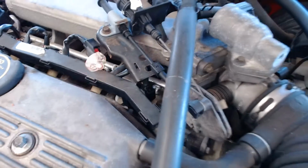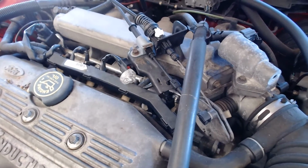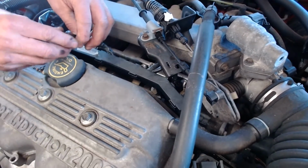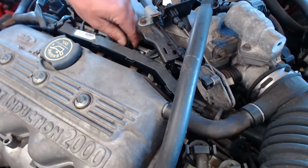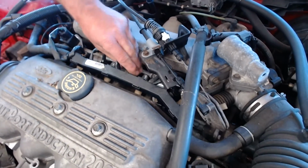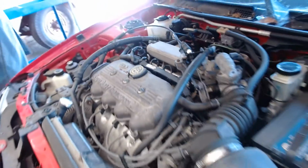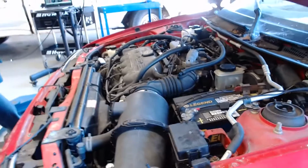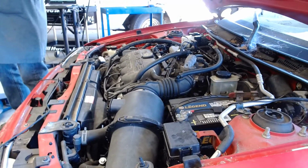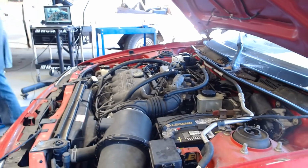So, is that injector being flashed? Sure is. So now, look you guys, if we got gas in the tank, and the fuel pump's running, and the injectors are being triggered on and off, we don't have a fuel problem. Everybody agree? Let's say it didn't want to start at this point, we could have an ignition problem, or could we have a timing belt that slipped timing and it's not running? Yes, that happens once in a while.